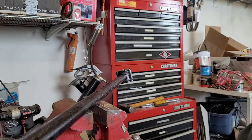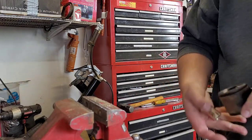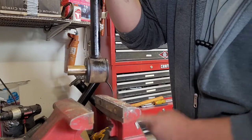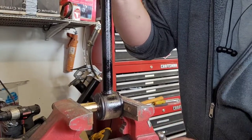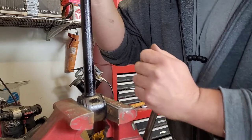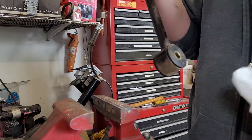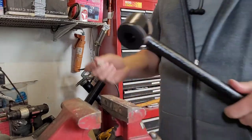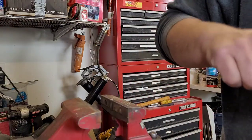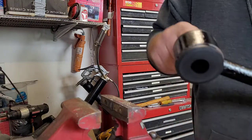I'm going to drop it on the floor. Taking my bushing bar, I'm going to make sure I have it on the side that I greased. With the handy dandy vise right here, we're just going to open up. Don't worry about the mismatched color spots — my paint can was empty but I've got some more. Just like that, it squeezes out a whole bunch on the backside — that's totally okay, not a big deal. Let's do the other side and smear it around just a little bit and apply a little bit more.